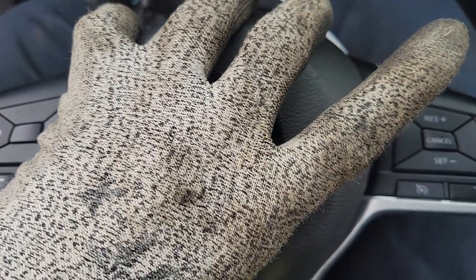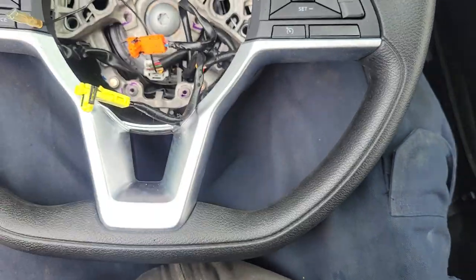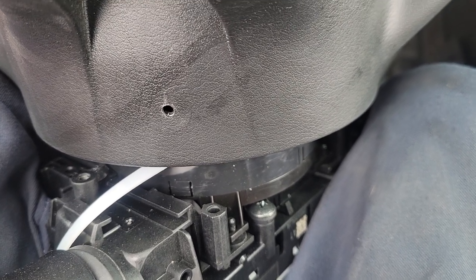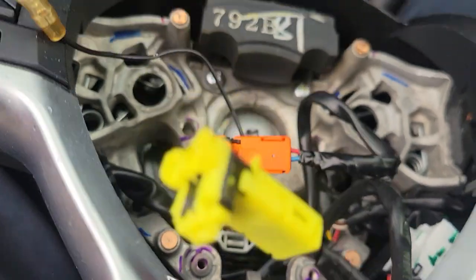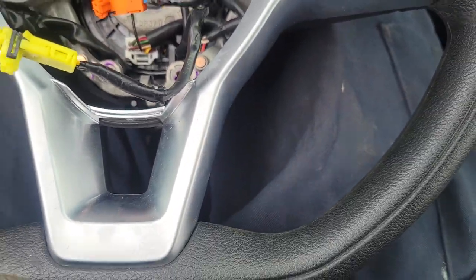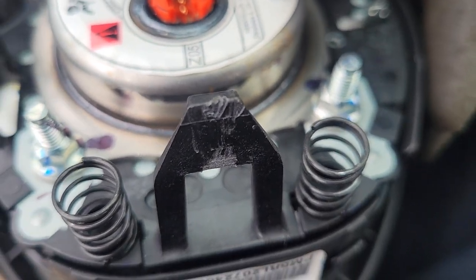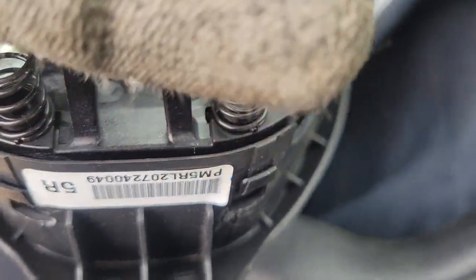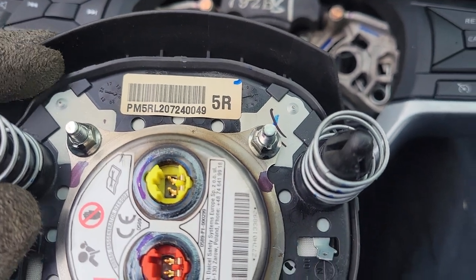On the bottom of this column you'll have just a single hole that you can access with a pick tool or some really small tool to press up on. You'll have this plastic tab right here, and that's all you're pressing against to unhook this. The spring pressure here will release the bottom of the airbag. Then you'll have the two top ones to try to release.